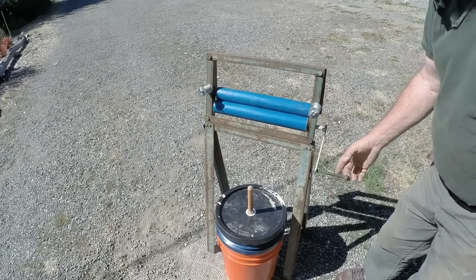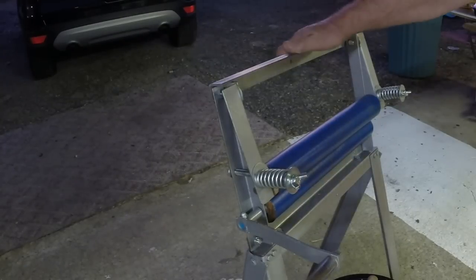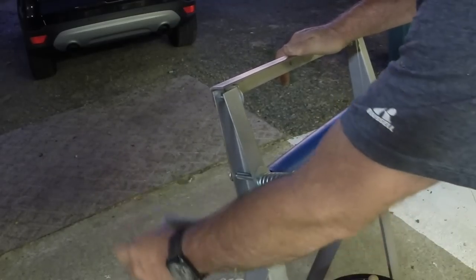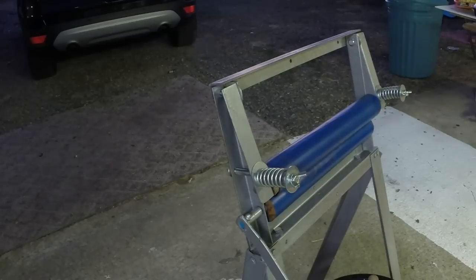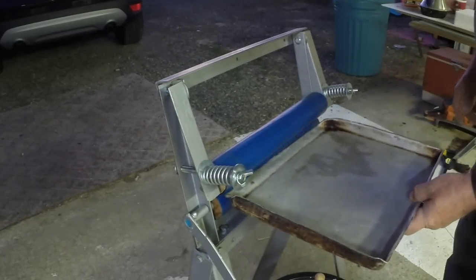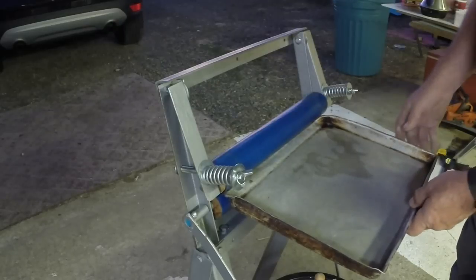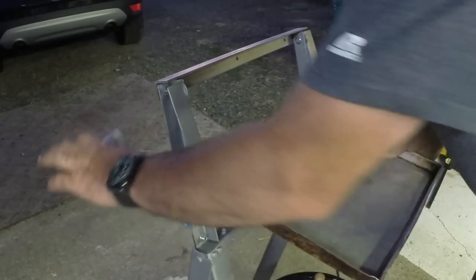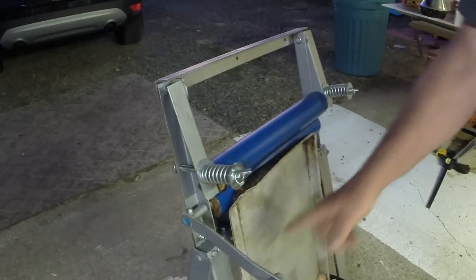Here's the washing machine down here, and then I have the wringer to wring out the water. We've got adjustment screws. Like on the old wringer washers, they did have a tray. So I got one of the old baking trays, and I want to put a bracket on the legs to hold this. I'll drill a couple of holes so the water drops back into the wash bucket — that way you're able to push right up to the center and then pull it on through.